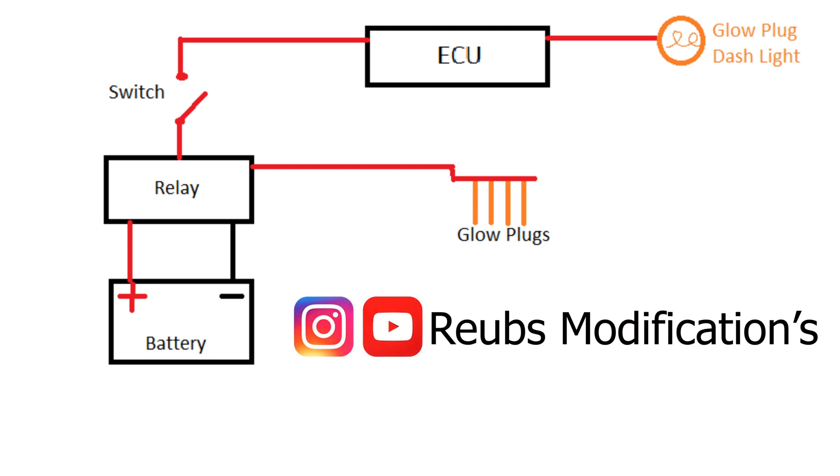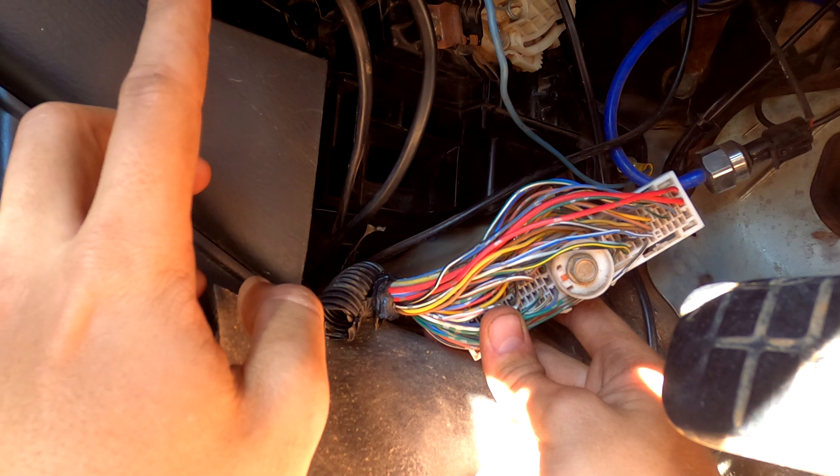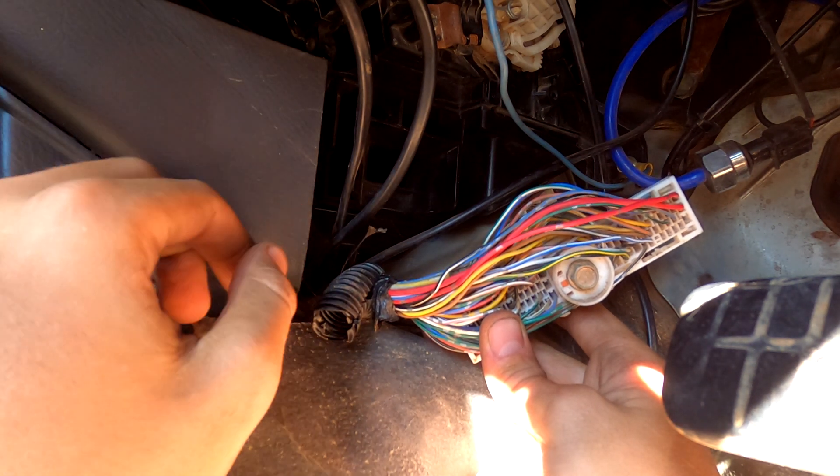So we can control when the car puts the glow plugs on. If we start the car on a cold morning and it wants to keep the glow plugs on for 30 seconds or five minutes, if we don't push that button they won't come on. If a switch is left on by accident, your glow plugs won't stay on forever — they will stay on for whatever the car's normal operating time is. So all the switch does is when the car sends a signal for glow plugs on, we interrupt that and say yes or no. If the car doesn't send a signal, we can't turn the glow plugs on — which doesn't matter because if the car's not sending a signal, the glow plugs don't need to be on anyway.